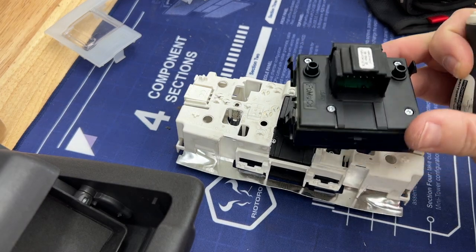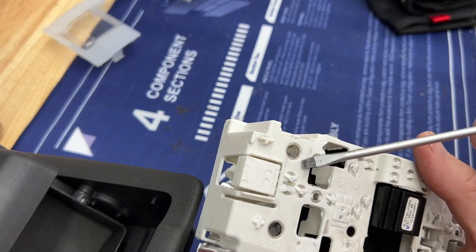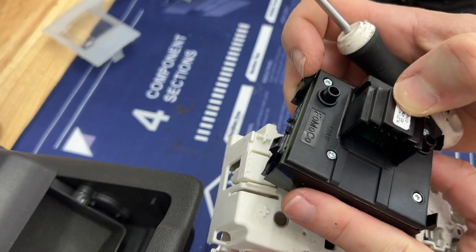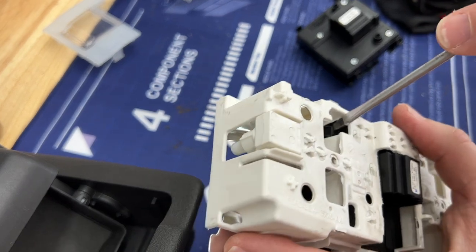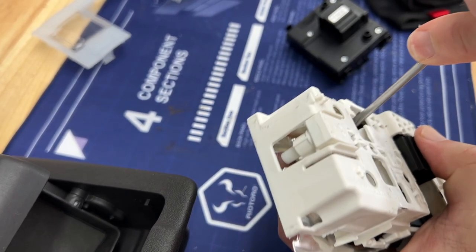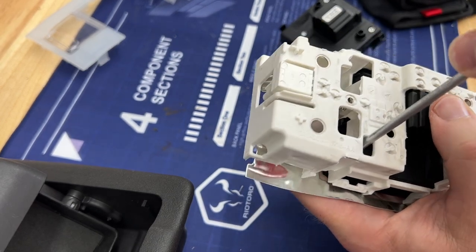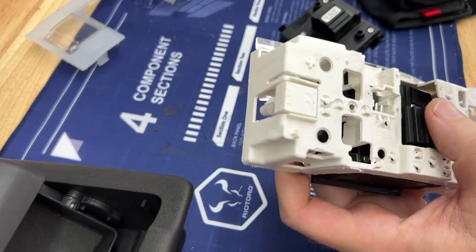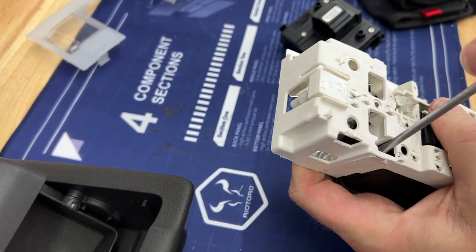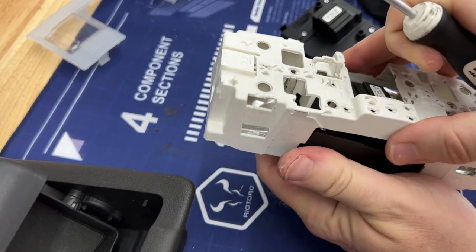Now that we've got this all apart, on the new part you can see where these four tabs are around the corners — and that's what we're going to unclip. So you can see in this top corner how it's shaped, and it needs to be pressed in like this to be released. So we're going to get our screwdriver in there, press it in, and then with my thumb on the back of this thing, try to push down. It didn't move much with just the first one, but I could feel it got released. The second one is in this slot — that one already popped out. Flip it over — you've got two more. Just take your time and they will pop right out.